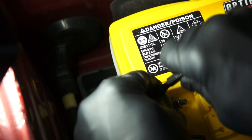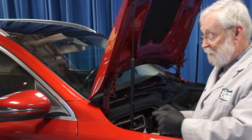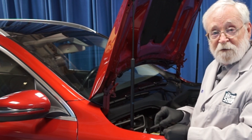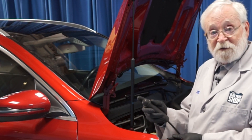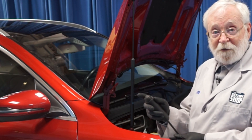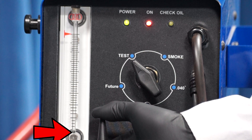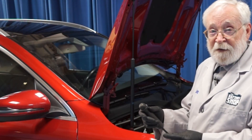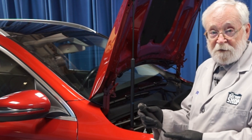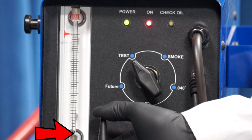Then, remove the elbow from the vent tube. Now, we can hook up our smoke generating device. The nozzle for the smoke generating device is a cone and so it'll fit right down inside of the vent tube. One of the things about these smoke generating devices is that they do have a controller. To turn the machine on and off, we simply press the button once to turn it on, press the button again to turn it off. And as you can see, when I push the button, it starts an airflow. As I put my finger over the cone, we'll see the little ball fall down because we have a blockage. And that's one of the first things we'll look at — when we activate this device, we want to make sure the vent tube is not blocked.